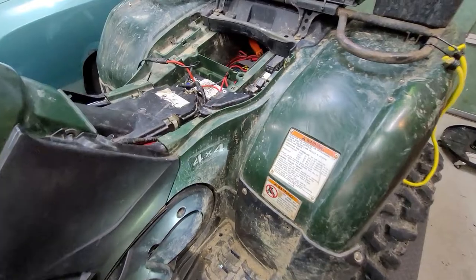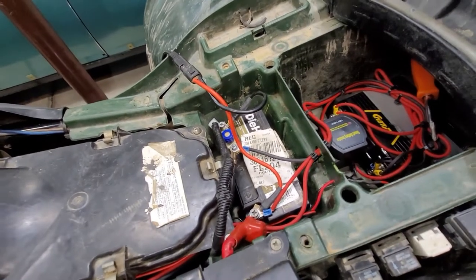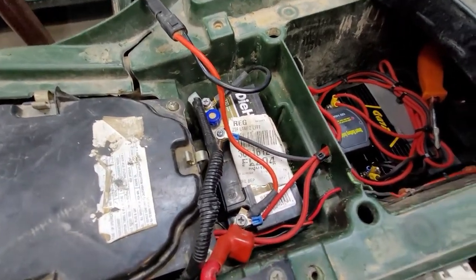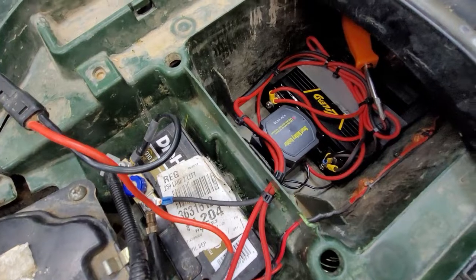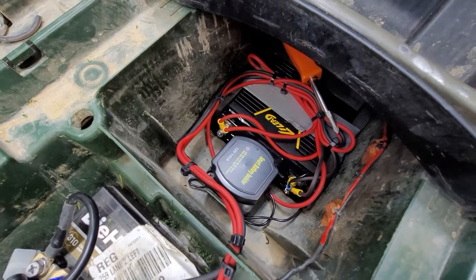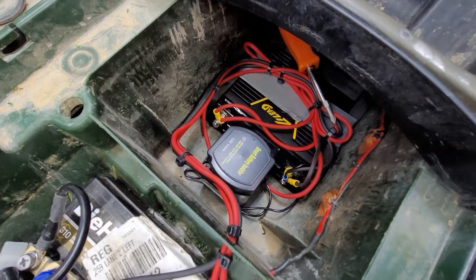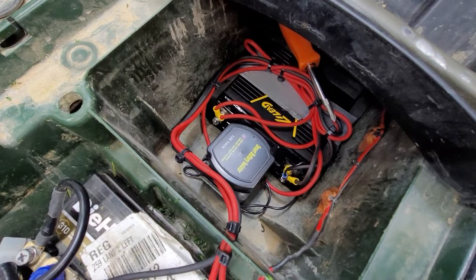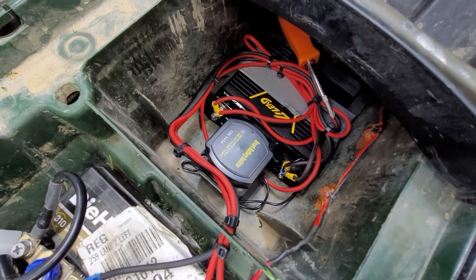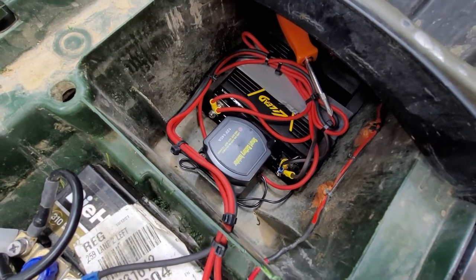The next step I took: I hear these systems are really prone to blowing the dash because of power surges and things like that. So I got a new die-hard battery this summer and I had this lithium battery on my Harley-Davidson. If anybody knows me, they know I hate this thing. It has 800–900-plus cold cranking amps for three-quarters of a second, but the Harley can't get past the compression stroke — you need that sustained torque to get it past, and this battery just didn't have it.